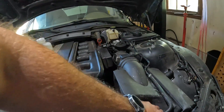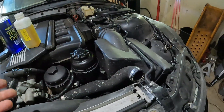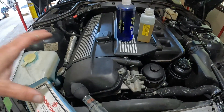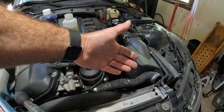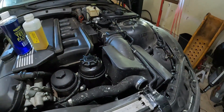It's relatively rare for a head gasket to just fail, especially on a BMW — usually there's a reason. In this case, the upper radiator hose failed and the vehicle overheated because it lost its coolant, which then caused the aluminum block to break down. The tension is alleviated between the head gasket and the block, and it then allows all of the exhaust gases into the cooling system because it's no longer sealed properly.